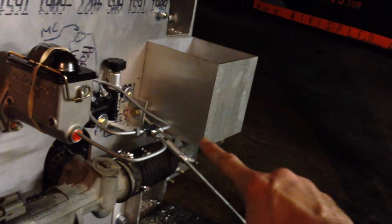Yeah, because the next piece of the crush structure is a 6x6 1/8 inch thick alloy of aluminum. I think it's 6063 that goes across horizontally. Now, these have to be short enough to go under it, and they are now. So yeah, one goes 48 inches wide from here to here, which leaves room for the wheels and tires, which are right here. And then one that's 6 feet wide goes in front of the wheels and tires for maximum crash protection.